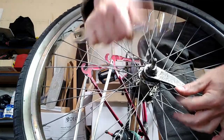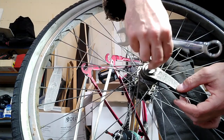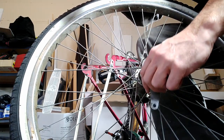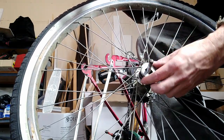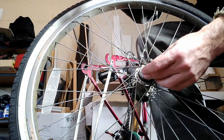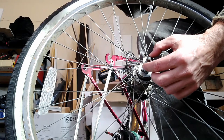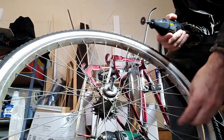You have to take off the nut and get inside where the bearings are and some of the other innards. Inside that tube are the two little tiny plates that are the actual brake shoes — you just get your finger in there and remove them. While the bike was open, I went ahead and put some more grease in there. If you don't have a grease gun, it's super inexpensive — go get one.